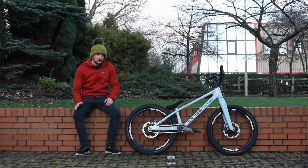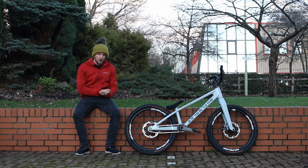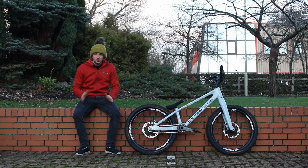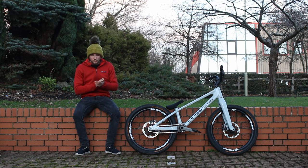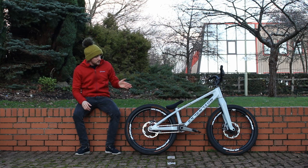I think it's the best way to go — you get a lot more braking force transferred straight into the bike, so you get less flex when you brake. It's honestly a lot stiffer. Apart from that, a lot of the calipers are post mount anyway. You don't get many with IS mounts apart from old Hope brakes. I've got braided hoses on those — been running those for years with no issues.